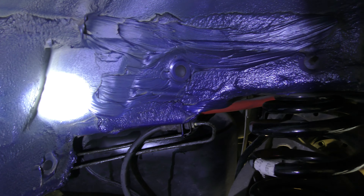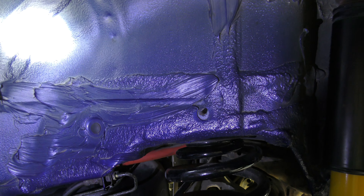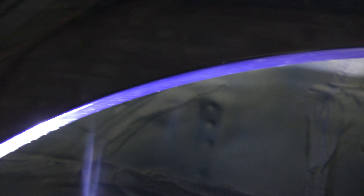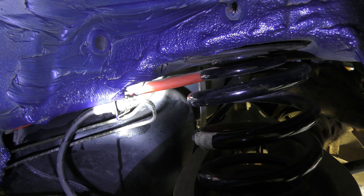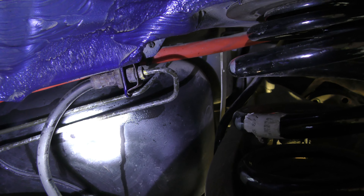First it was stripped down — remove the arch liners. They have lovely arch liners in these BMW cars. It's all just nuts and bolts, but be super careful because you can crack them like I did on one of the front ones. Once it's off, I'm pretty pleased on both sides. The actual chassis inside the wheel arches is completely spot on. Probably the main reason for getting in these arches is the lips underneath need to be cleaned, dried, treated and painted — that's where rust always gets you and always ends up costing a small fortune. I won't paint the brake lines because even if you paint them they'll still rust, and I want to monitor their progress before I definitely need to replace them.